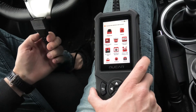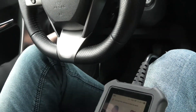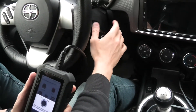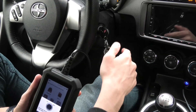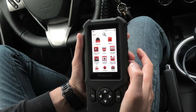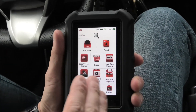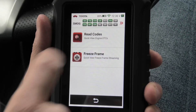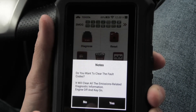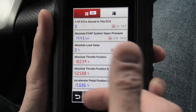Right now I will connect this connector to the OBD port and test the unit. This vehicle is located right here. After you have connected the port the next step is to put the ignition into the ON position — in this case you have to turn the key twice. If it's an engine start and stop button you have to press it twice. After that you can press start. I will show you the free options that come with the device right away: you can read codes — right now no fault codes found — and you can also erase fault codes. Now the live data stream immediately populates all these parameters with live data.